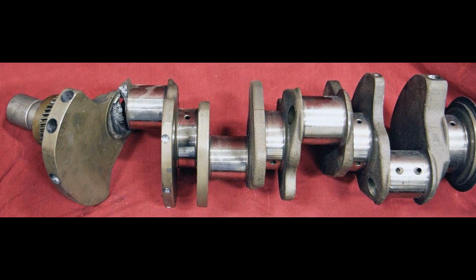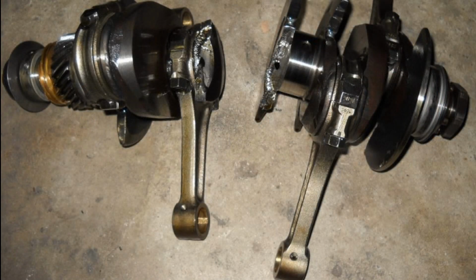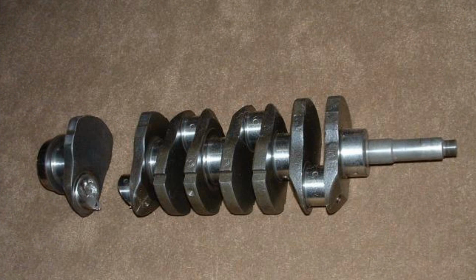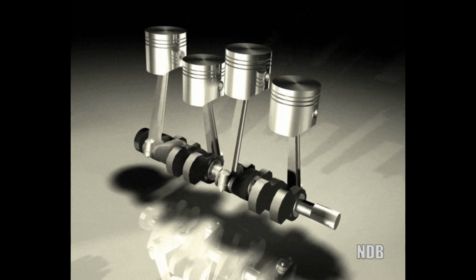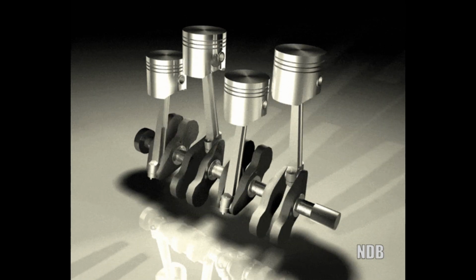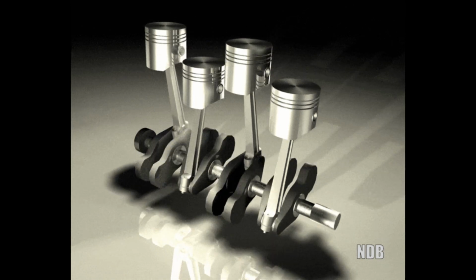In some cases, the resonance may stress the crankshaft to the point of cracking or complete failure. The harmonic balancer helps minimize torsional crankshaft harmonics and resonance. The damper is composed of 2 elements, an inertia mass and an energy dissipating element. This element is composed of synthetic rubber, a clutch, spring or fluid. The mass counteracts the torsional crank motions in concert with the energy dissipating element, which absorbs the harmonic vibrations. In other words, you need it. So here we go.